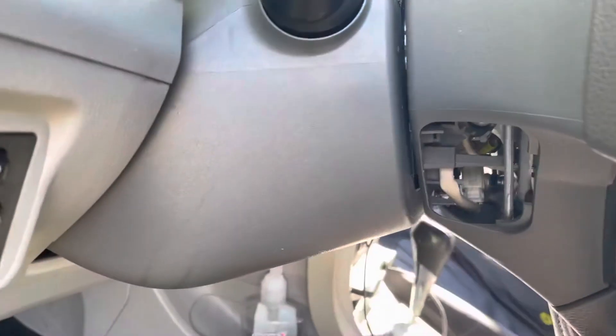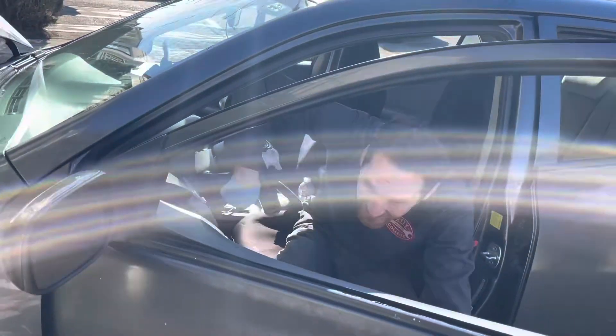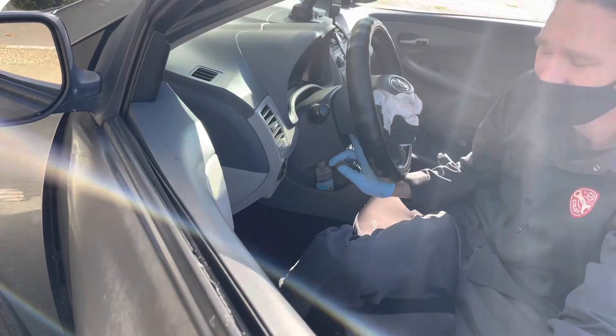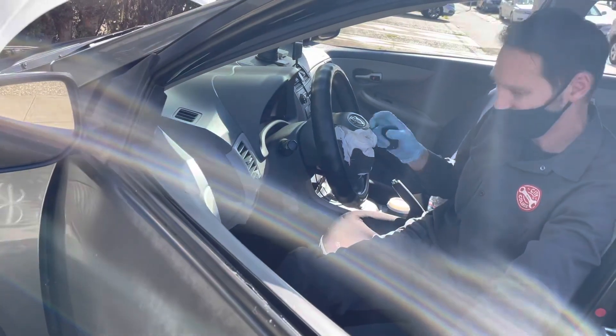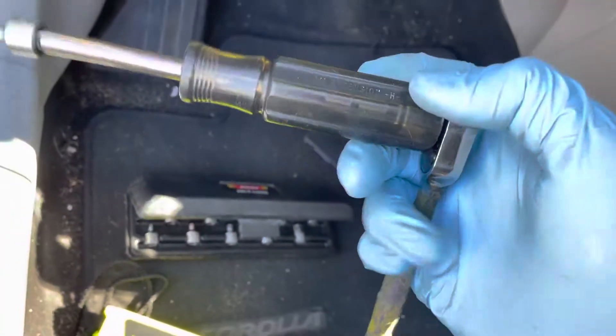There's a little panel in here, a small cover that will pry off, and inside here is a small Torx fastener — same on the other side. So I'll undo these two Torx fasteners and then this whole airbag assembly will come out. It's quite tight — you've got to put a lot of torque into it to turn it. It's a captured nut, so the nut goes into that little plastic clip.